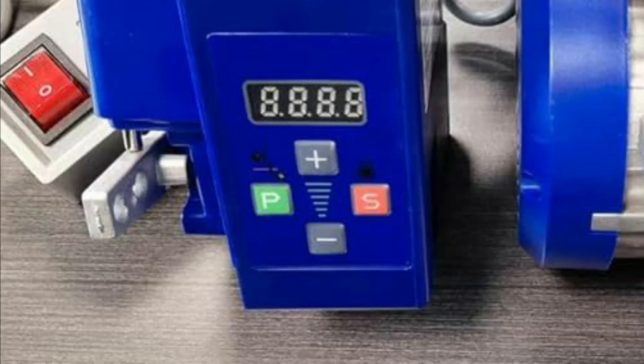In the same way, C02 allows you to check the voltage of the power supply to your sewing machine. Press the S and P keys simultaneously to see the C01 display, then use the plus button to change to C02 and press the P key. Your display will show the voltage of the power supply. The voltage should remain at a constant value of 230 volts. Any voltage that is too high, too low, or fluctuates too frequently from 230 volts may cause damage to your servo motor.